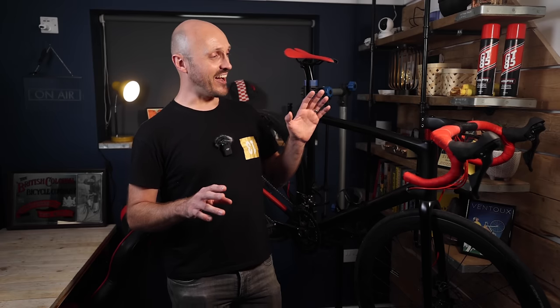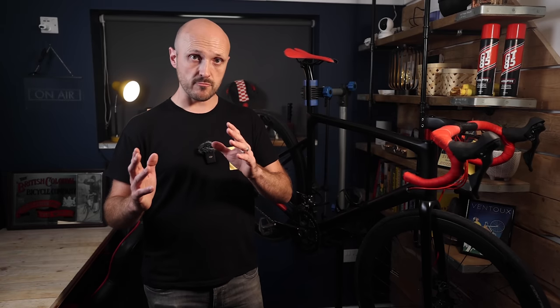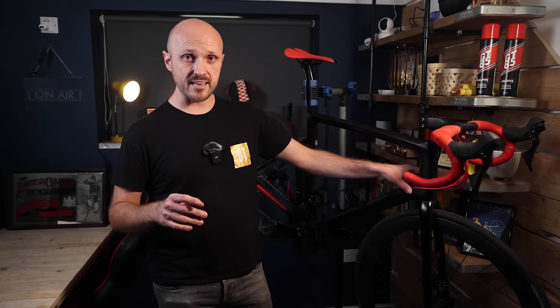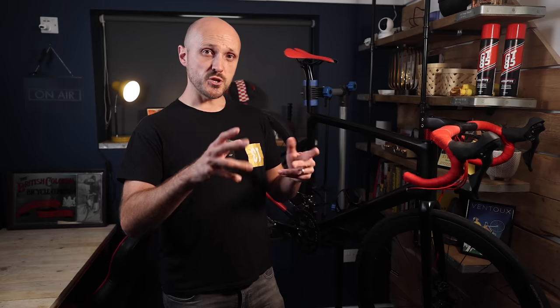From the day of the second purchase it took exactly two weeks to arrive, and I was pleasantly surprised to see how well it was wrapped and packaged — plenty of soft foam around the frame and lots of padding inside the box. Putting the frame together was fairly straightforward, although just as Luke from Trace Velo found, there were some issues with the holes in the sides of the down tube that the brake cable housing feeds into. They seemed designed at right angles to the frame instead of being angled in, so the cables tended to stick out. I fixed this by buying small files and gently rubbing around the hole to enable the cable to lay closer against the side of the bike.